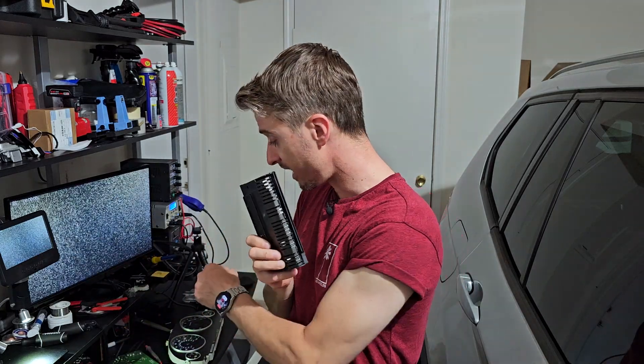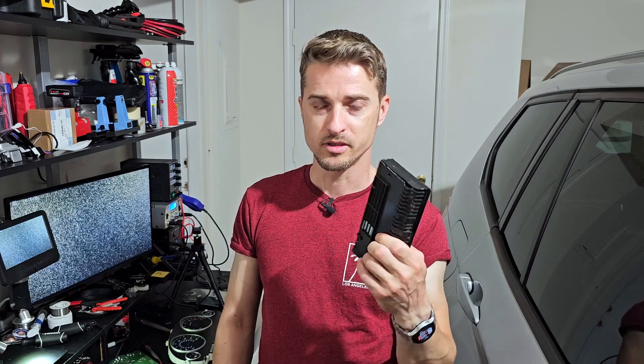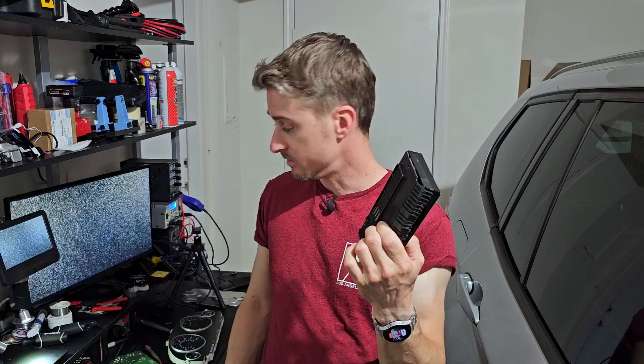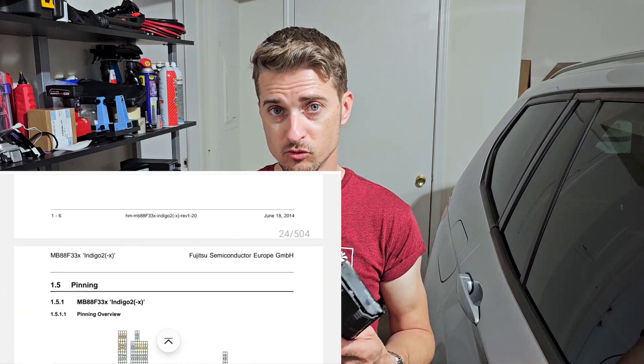The next step was to find a way to code this module — this brain — to work without that face. I coded, recoded, and overcoded until I almost broke the car. I didn't break it, but I was not able to find the option. The problem was the alive signal for the LCD. This brain didn't have the alive signal from the processor, and because of that it had internal errors and the cruise control didn't work. Unfortunately I can't simulate that signal because it's a communication protocol between two processors — it's not a simple 12V or 3V/0V signal.